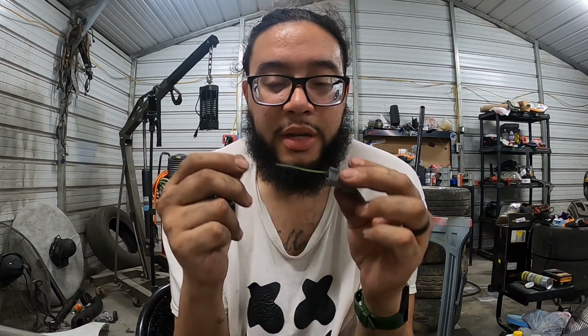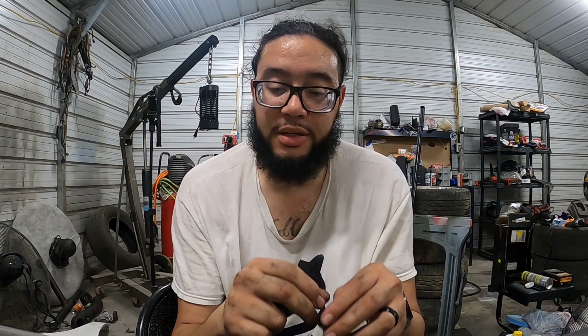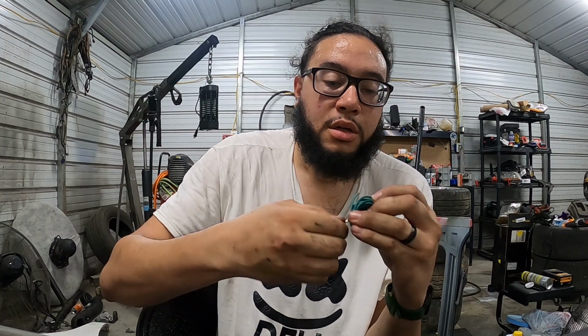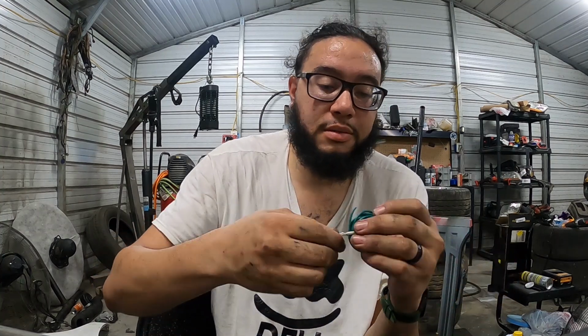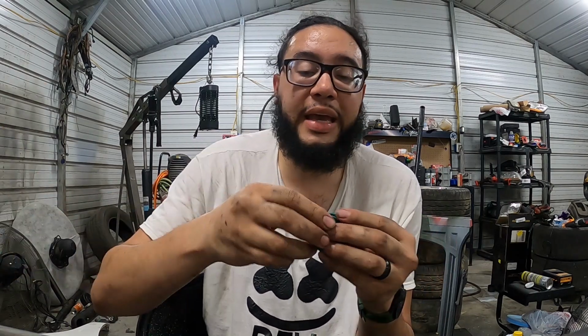And if you're running OBD1 chip ECUs, I want to say anything really that you're gonna tune, you don't have to do anything else but hook this one wire up and it will feed fire to the solenoid and VTEC shall cross. So what I'm gonna do now, go ahead and get the wire first soldered to this plug and then ran through the cabin to pin A4, which is the VTEC pin out on the computer.